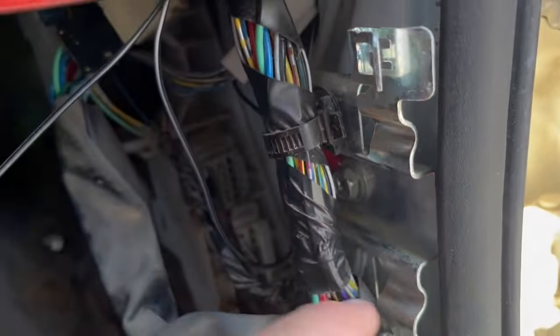I was just chasing some electrical issues - it seems I mixed up my wires. The wires coming from your turn signals: the one with the white stripe is your positive, the one that's just solid black is your negative. I've grounded out the solid black one on both sides. On the driver side, the black wire with the white stripe goes to the blue wire with the white stripe. On the passenger side, that black wire with the white stripe goes to the pink wire. Now I have it all plugged back in - we'll turn on our turn signals, and just like that, they work on both sides.